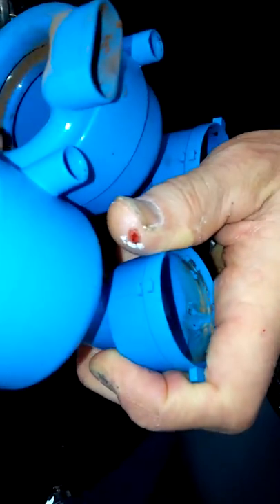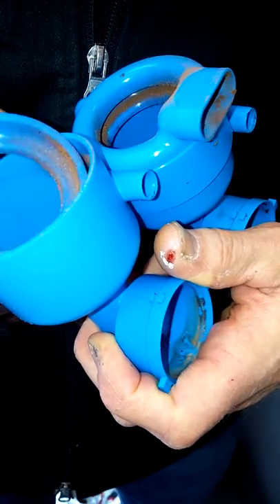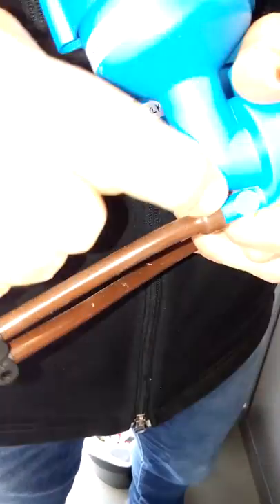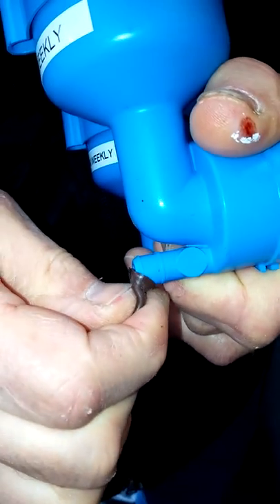When cleaning, clean three parts of the bowl in the sink with warm water and reassemble, especially checking the base, the outlet hole, and the tubes. If you have a blockage, pull the tube off and check for a good flow through that tube to the outer nozzle, in case there is a bean or milk product stuck in these tubes which will re-cause another blockage.